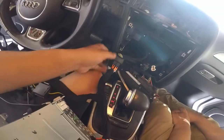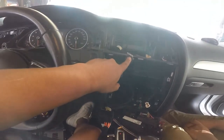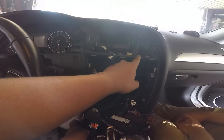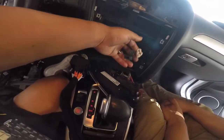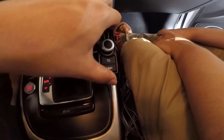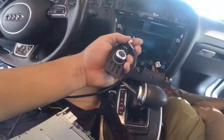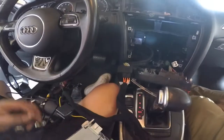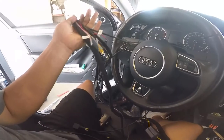So this T-harness basically connects to the original wire harness and connects to the new screen. We're not going to use this one — it's actually the emergency lights — and these are the air vents. There's a navigation button that's going to go right about here and plug up to the wire harness. All the other wires are for the backup camera, but my brother didn't get it — he'll get it later.